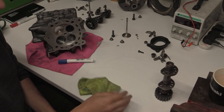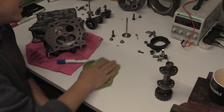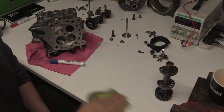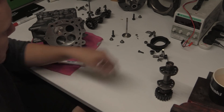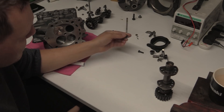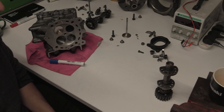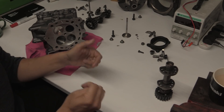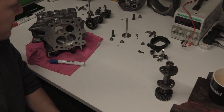I imagine you get up to 100 degrees — maybe even less — and the thing will just pop. There is a way to demonstrate that: change the bottom shim so it's way too tight and get rid of the spring, then just run the engine. It gets to temperature and then you'll just hear it go — boom boom boom — as it's popping valves off. So yes, it's not a springless system, it's about where the spring is.